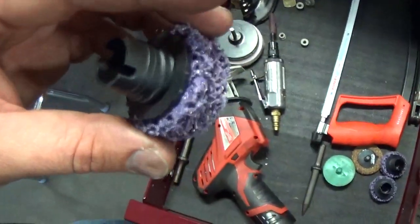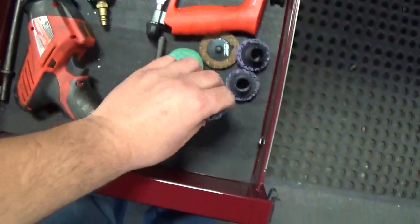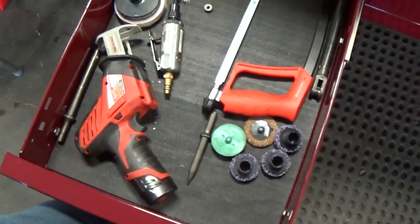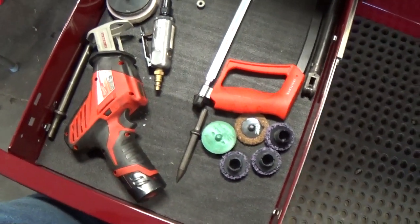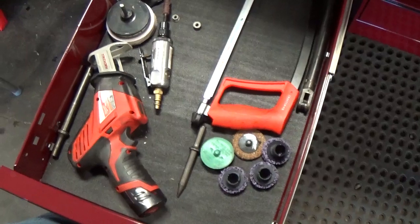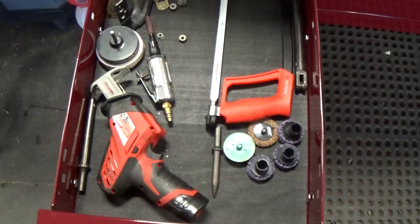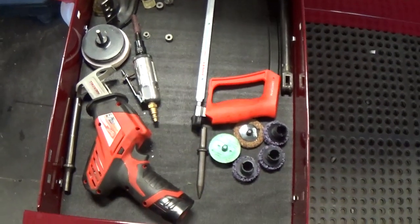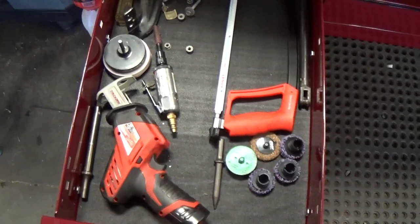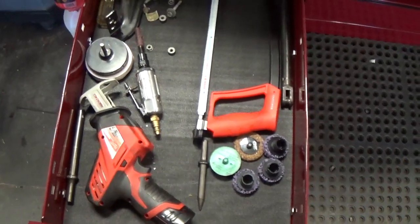And I go an extra step with this too. I do around the lug nuts, and then I also take a sanding disc to the rest of the hub to make sure it's rust free before I put the brakes back together. Make sure that you're getting the wheels torqued back down properly, that your rotor is going to be running true, because if you install a rotor and a wheel over rust, that's not a level surface. A lot of mechanics make that mistake, especially your quick and dirty guys. They don't go the extra mile, so you really have to do that. Get your hubs clean before you remount that brake and tire package.